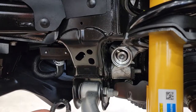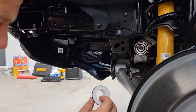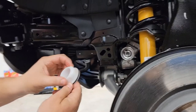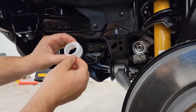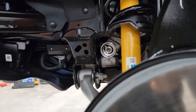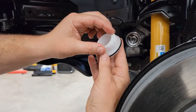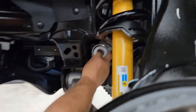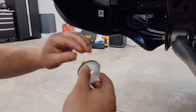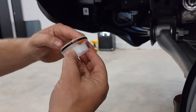Now it's time to put in our Bronc Buster bushing. Here's our part — we're going to put a little bit of grease around the edge. You can see there's a little swollen part, almost a cam, and that's going to line up with the cam in here. It's going to go in with the numbers facing out. So this cam-for-cam area here is going to line up with that cam area. I'm going to put some grease around this O-ring — just a little bit.